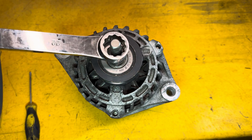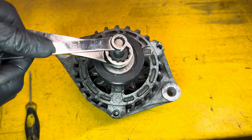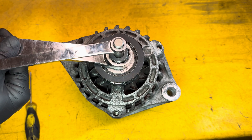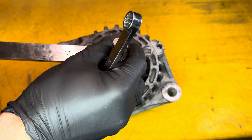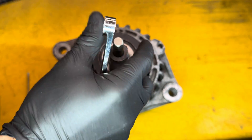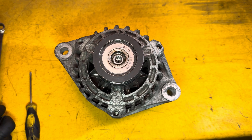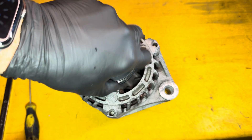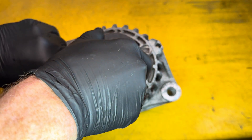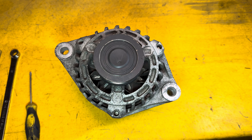Make sure you have the right size on, then try to turn the actual pulley clockwise whilst holding the alternator. It got a little stuck in there — there we go — and then pop the cap back on. And that's how it works. Thanks for watching — hopefully that explains most of what there is to know about overrunning alternator pulleys.